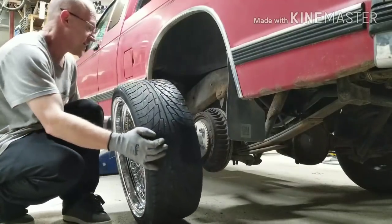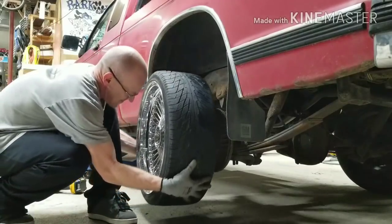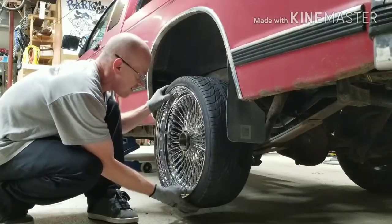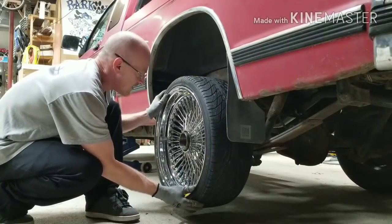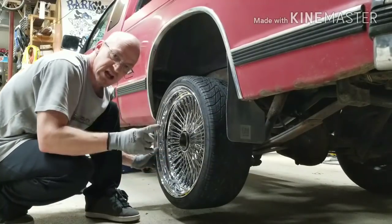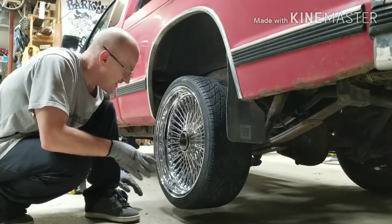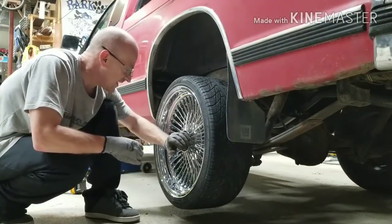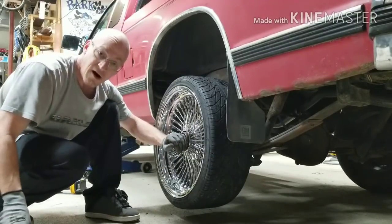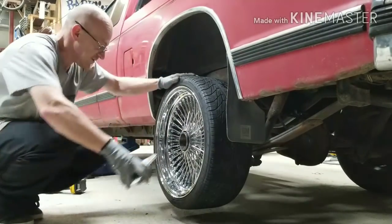Here's another important thing. You always want to make sure that you get your wheel locked in right on here. It is possible to have these teeth right on top of each other and it stay for a while. Then you'll hit your brakes and you'll hear a noise, and you better stop almost immediately without using your brakes if possible, because when you hit your brakes, you're stopping the hub, and the wheel will spin the knockoff off until it does fall completely off. I've lost some wheels.